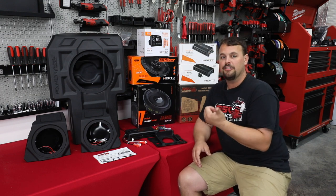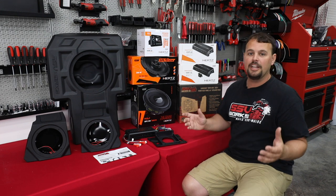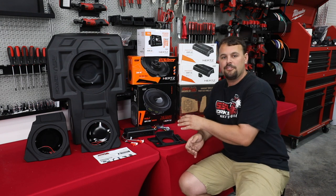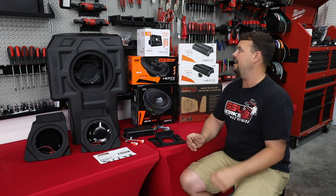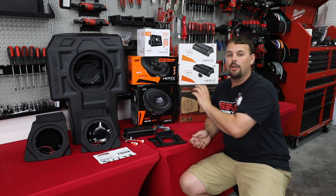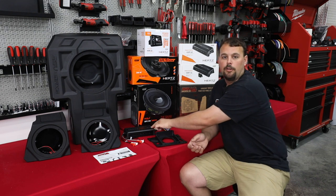We're also going to be using two Hertz amplifiers in this install. This is a custom build, so I'm not going to go step-by-step on how we did it, because this is not in a plug-and-play configuration. We're using the Hertz HMP4D, which is a very popular amp for us to use in our Harleys — it's IPX rated, fully submersible. We're also using the HMP1D, which is our monoblock sub amp. It's going to be giving us in the mid-300-watt range RMS power, 600 watts max to this Hertz sub. Same size, same IPX waterproof rating.